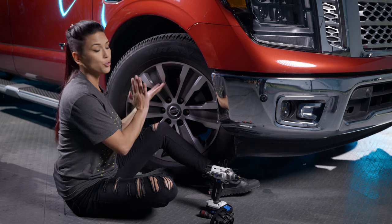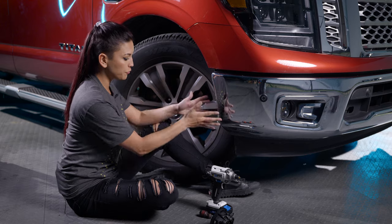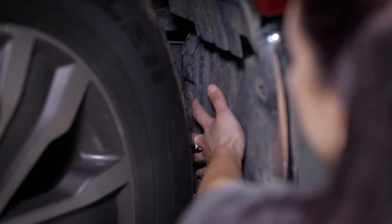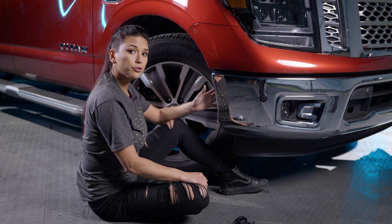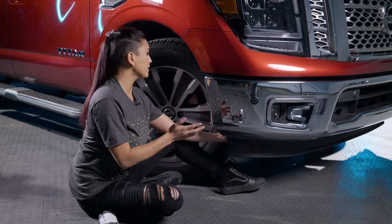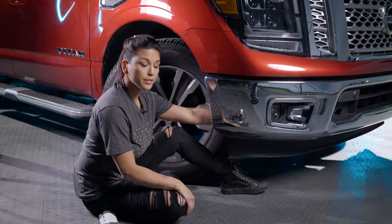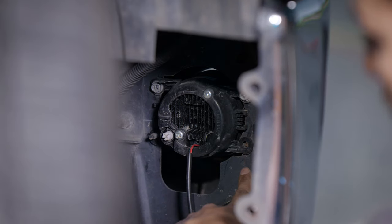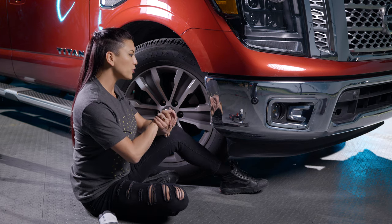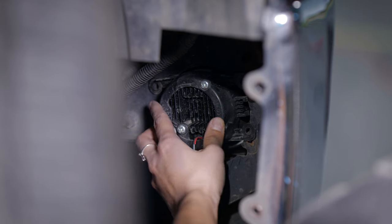To get started on the vehicle install, turn your tire and wheel to give yourself a little more clearance in the fender well. There are three Phillips screws to remove from the front part of the fender well — the first two are on the front bumper and the third is inside the fender well. There's also one last screw on the very base of the bumper; remove that and the plastic piece will come out. Once you've got those four screws out, the plastic trim piece slides right out. Next, unplug your fog light harness, then remove the four screws holding the fog light — one at the top, more around the housing, and one nut at the base. Remove the top two screws and then remove your old fog light.